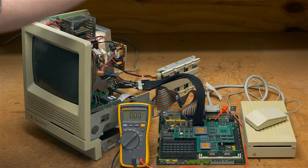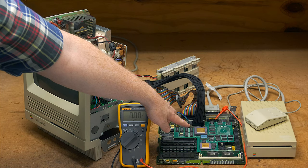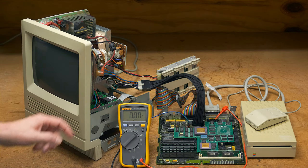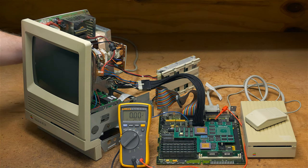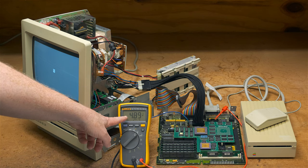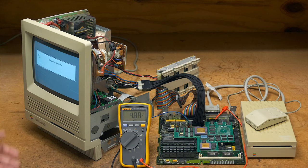Now let's give our extension cable a test. I have my external floppy drive connected, the mouse connected, also a hard drive connected. The socketed 50 MHz Daystar Power Cache accelerator is connected. I've got my speaker wires extended, and I have a Fluke voltage meter set to measure on the five-volt line on the internal floppy disk connector with the ground connected at the chassis ground where the power supply connects. Time to flip the power for the smoke test. We got the beep just fine — about 4.85 volts. The voltage was a little low at first, going up to 4.9, slightly lower than five because we've got accelerators and other things going on. But basically we can do all manner of testing now.